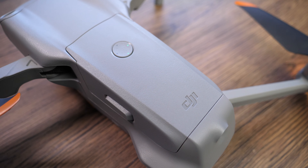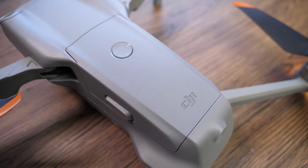Since this is a firmware update for the battery, you'll want to make sure you update each one of your batteries' firmware too. There are a few people having issues with the update completing. If that's the case, disconnect everything, reconnect everything, and try basic troubleshooting steps — maybe reboot the phone and reboot the drone. Make sure you have a solid data connection and at least 40% on your drone battery to perform the update. If you're still having issues, reach out in the comments.